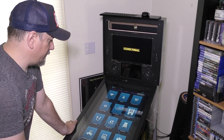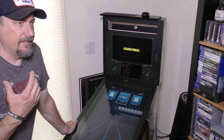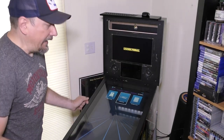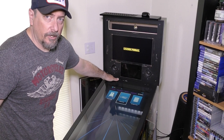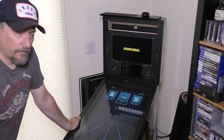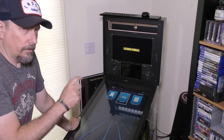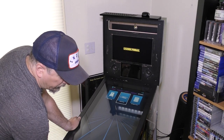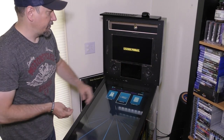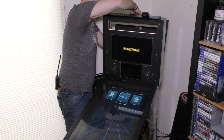And like I said, we can go in here and just go to the menu to do the HDMI pinball setting, but I was thinking about it and the problem is there's no way to get back without the button being up here. You can see we've relocated everything, so there are no OTG PC connections on the top. So what I'm going to do is run another button on the VIBS board underneath here to be able to flip the channel, so it's either normal mode or OTG mode. And then I'm also going to put one more plunger or button under here for turning the PC on and off, which will control this screen as well. So let's go ahead and turn that on and see how it looks together.